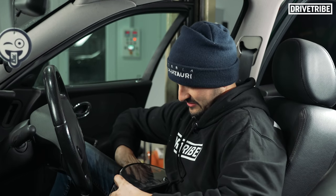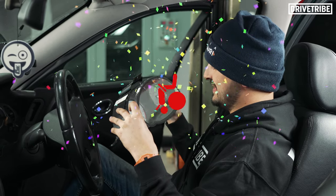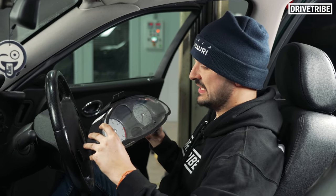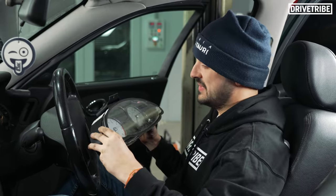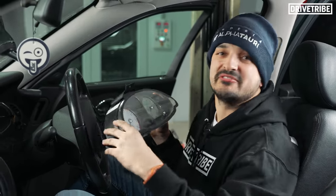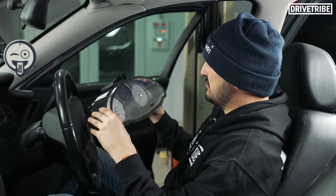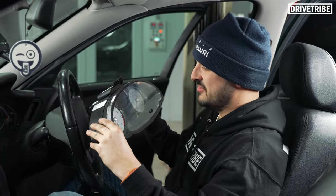Off comes the glass — there it is. And it is, drum roll please — the airbag light. What I think has happened is someone at some point took a seat out of the car and unplugged the airbag cable without disconnecting the battery. A car does not like that, and then that will sit flashing at you as you drive along, so someone thought — I'm just going to put tape over it. What they could have done is just reset it and put the seat in properly. Nothing too serious — just clean off any tape residue and crack on.